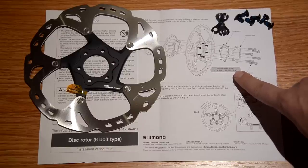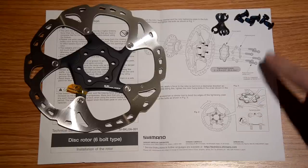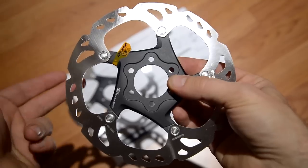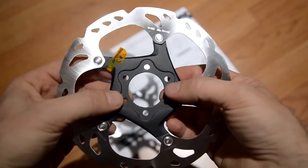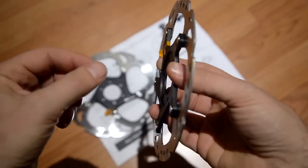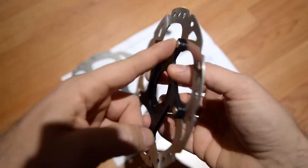The tightening torque recommended by Shimano is between 2 and 4 Nm per each bolt. Before getting it installed, let's take a closer look at the disc. What I have here is a 160; the one at the bottom is the 180 that I plan to install at the front. There are two sides to this disc — this is one direction only, and it can only be installed one way. You can see this spider protruding out on the inside.